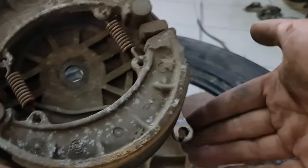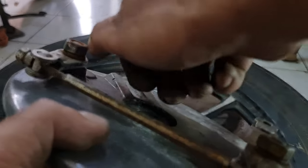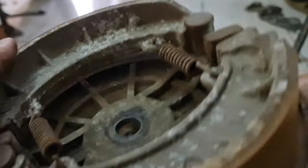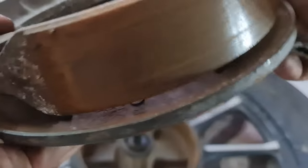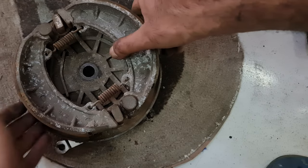Ideally, when we pull this lever, this piston should move — but it's not moving. That is why they were jammed up, so these have to be removed. Even though these were loosened before opening the wheel — I think I forgot to record that — but these have been loosened. They're not moving, so a little more WD-40, removal, cleaning, and it should start working.